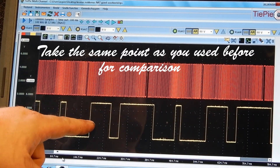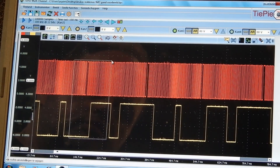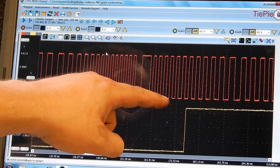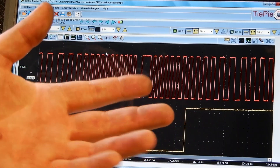Using the same rising edge reference point and counting the teeth again: one, two, three, four, five, six, seven — exactly the same. So what have we got so far? No fault codes. We don't think it's a fuel problem because adding fuel doesn't change our situation. We checked the timing and it matches the known good. However, this car only has one camshaft signal and there are two camshafts, so we basically only checked one camshaft. Keep that in mind.